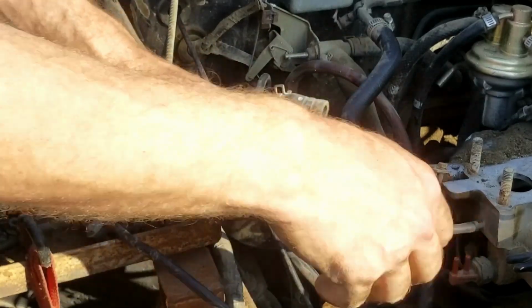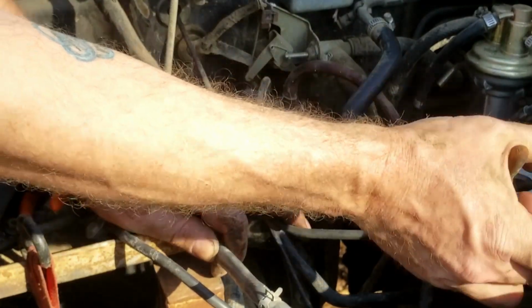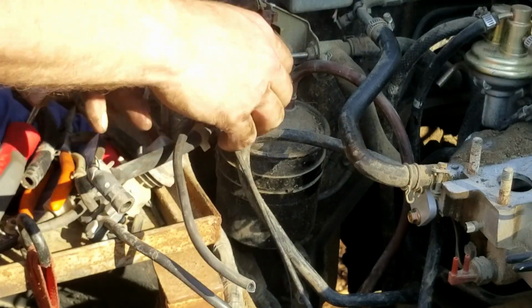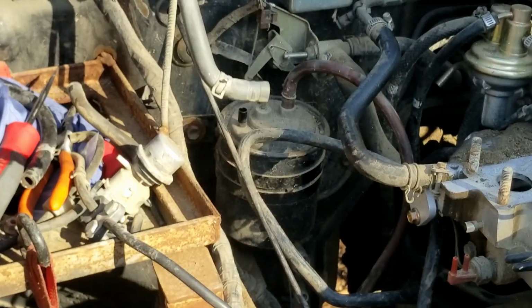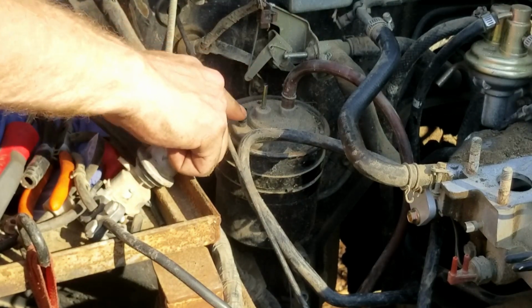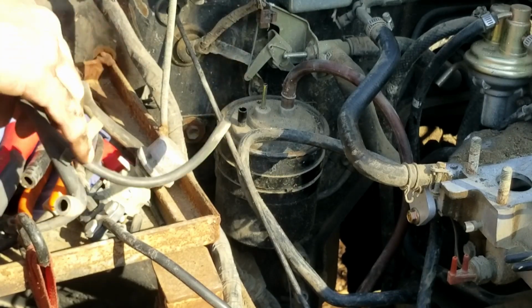Should you be worried about high water or mud entering these 2 lines and plugging the canister, use 2 small lawnmower fuel filters and short lengths of these hoses to reroute the canister ports to higher ground, but do not plug these ports. When plugged, you may suck a vacuum in the gas tank and prevent gasoline from being pumped into the engine. That's an extreme case.